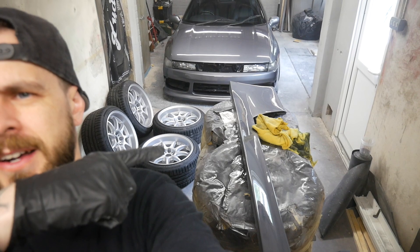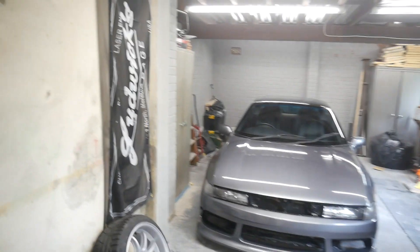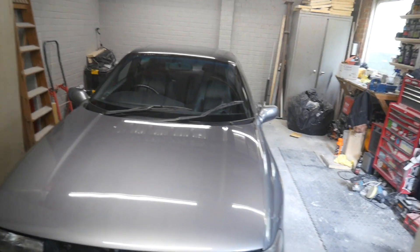The bumper is painted, side skirt is painted. There's a fun story behind that — when I was painting it, base coat went fine but lacquer not so good. The compressor decided to spit out a load of water which ruined the clear coat, so I had to rub it down. I freaked out thinking it would happen again, so I switched to my turbine sprayer. It worked fine but came out a little bit chunky on the clear coat, which is going to happen with that turbine system.